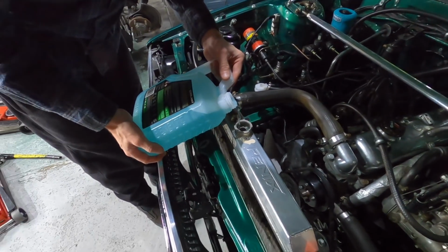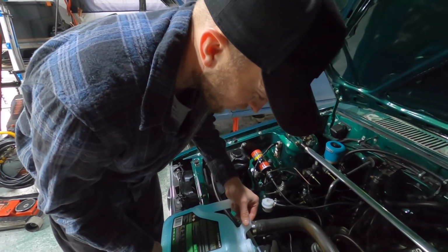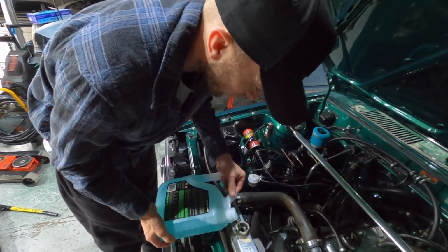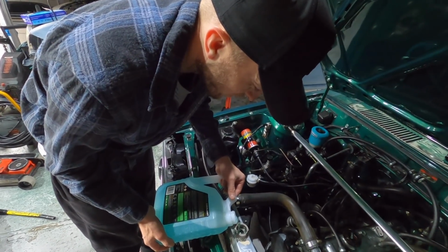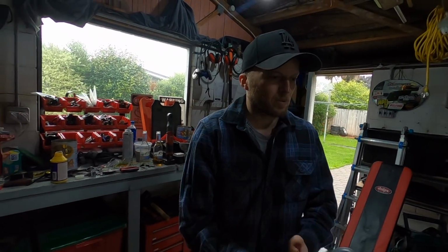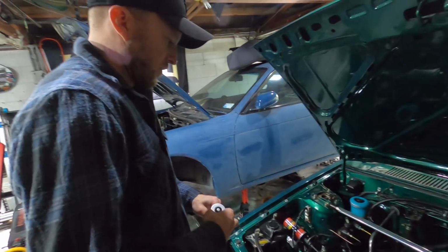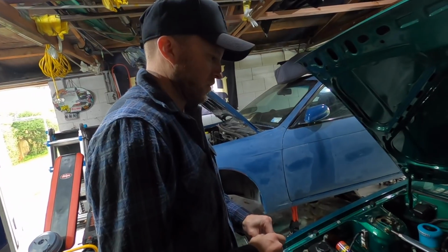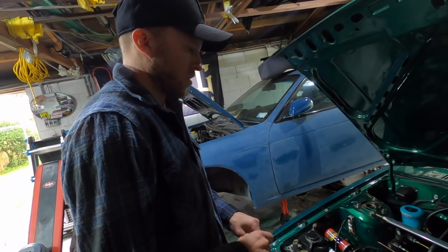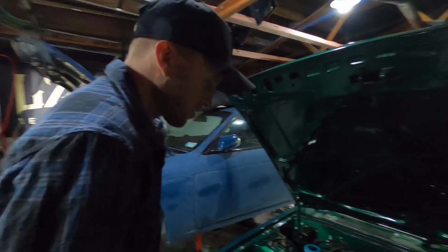The only thing I'm concerned about now is, it sounds all good, but without driving it, I don't know if it's going to have any weird flat spots or anything. But it sounds like it revs pretty good. So now I'm going to reset the tappets again because you're supposed to do them when they're hot. You set them up cold just to get it running, and then you reset them again when they're hot. After I've done that, I'll see if I can borrow Dan's timing light and check that it's bang on. Then we'll sync the carbs, and that'll be it, I think. But you will see that in the next video of this car.